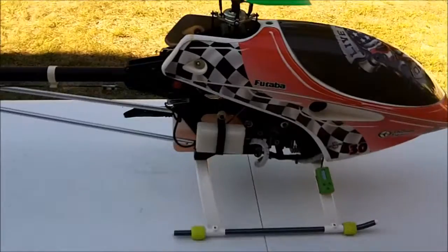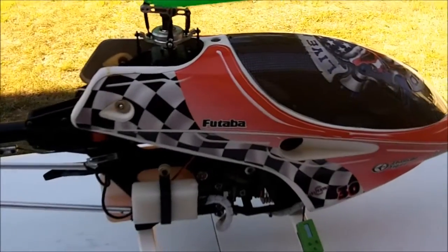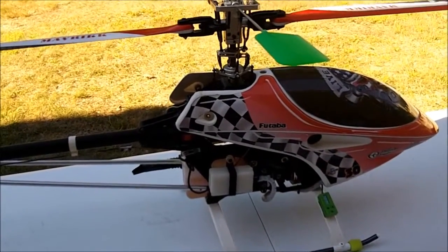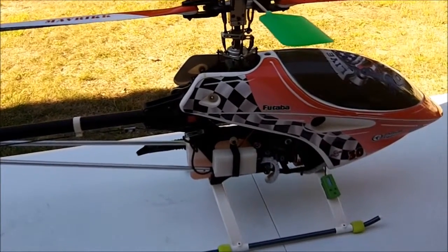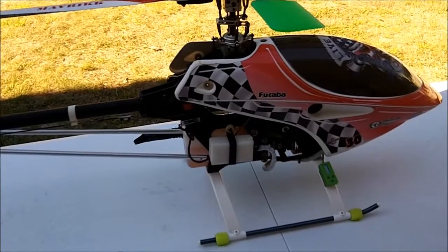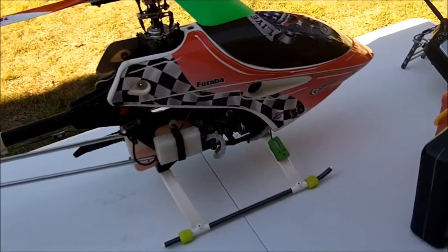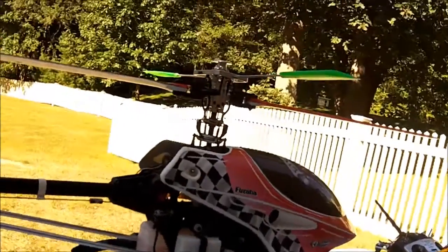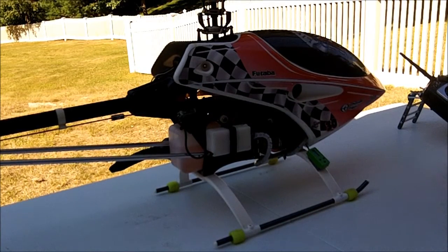I just want to open it up and show you everything going on inside. So far it's been running pretty well — you're getting about 45 minutes of sport flying on this. I'm not a 3D flyer, I'm a sport flyer, so 30 to 45 minutes in moderate temperature. If it's really hot you're getting about 15 minutes and you have to let it cool down because of the high heat. I still haven't figured out all the heat issues with this bird, but I wanted to go over it because you never really see too many of them and there's not a lot of information on the GO engine.